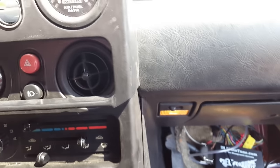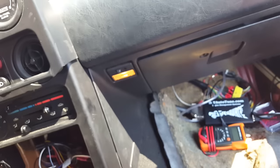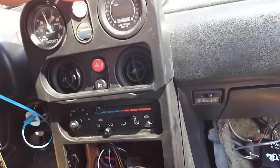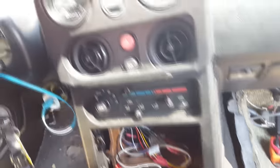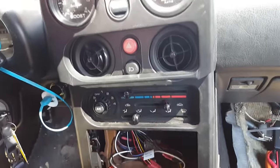It's a little annoying — it's plastic with not very deep foam behind it, but the screw will catch. Same thing on the other side. I'll make a cap to cover the whole thing so you can't see the screws. This is for the wideband obviously, which is what I'm installing today to help my Megascort tune better. I'm gonna start cutting this up and I'll have to drill a hole in the top of my dash back here to feed the wires through.